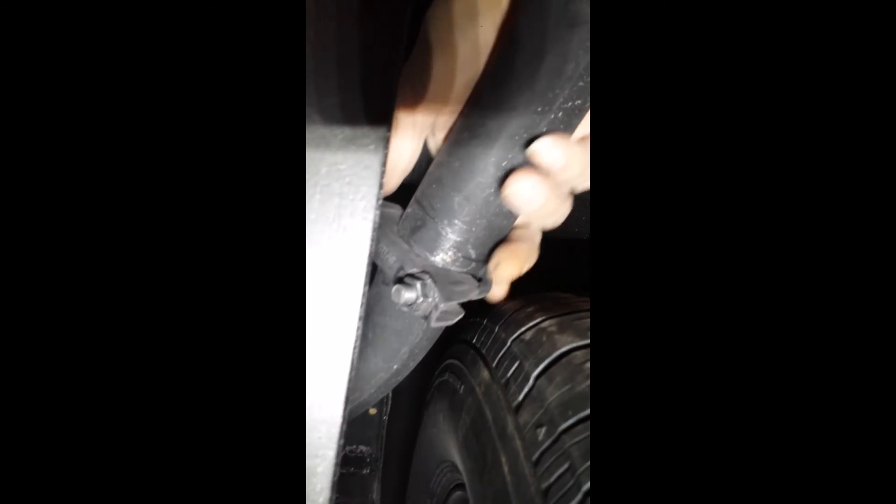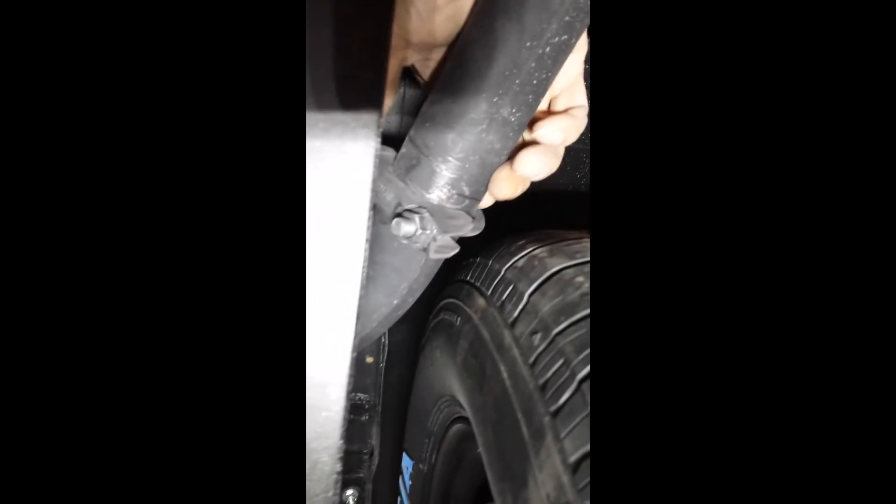If you can see that hanger bracket up in there — I did notice when I crawled under here that the clamp was actually a little bit too far ahead, and it was stretching this loop-style hanger. Nothing like the new style. I thought it was trying to push that exhaust forward, so I did move it up ahead a little bit. I've tightened up both sides of the muffler, but there's nothing under here so far that I found that'll make it rattle. It wasn't a thump-type noise like a shock trying to pound a new hole in the tower — it was a definite rattle.